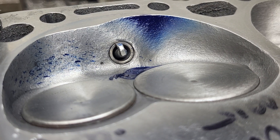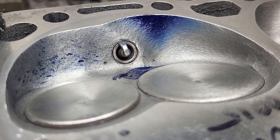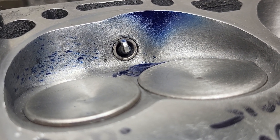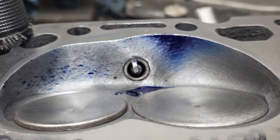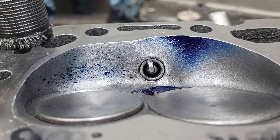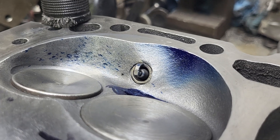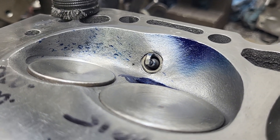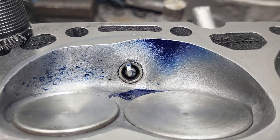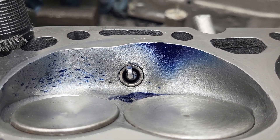What we did today is we tested this at two different depressions with different valves - the intake valve and the exhaust valve is what we used last time. The splatter you're seeing here is at 35 inches of vacuum, which is about as much as I can pull on my SF 600 without having problems with the oil squirting out. This is also a different port - I forgot to finish the exhaust but we're only doing intake today. Let's take a look at the splatter and so forth.